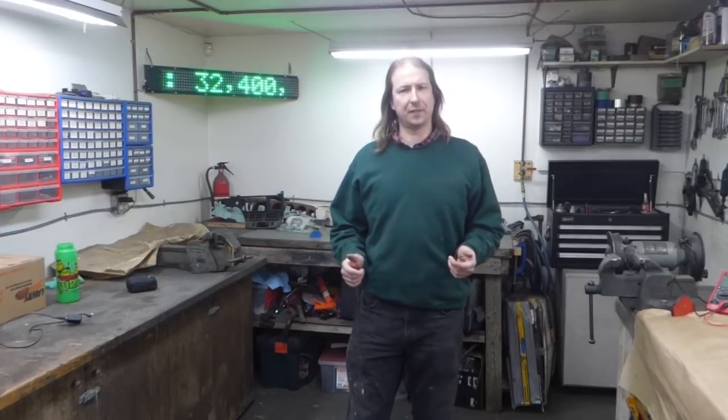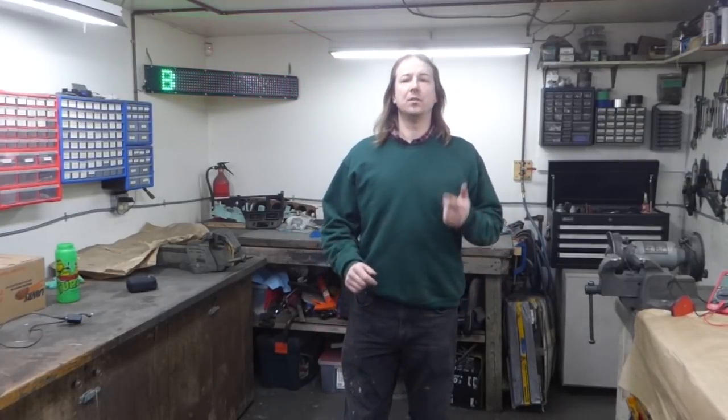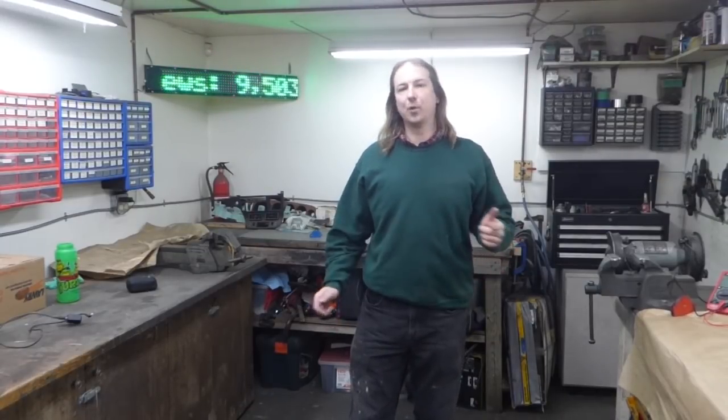So what I'm going to do is design a custom control board that has all of the I/O that I need. And I'm going to do things a little differently. Normally I would etch these boards myself, but in this case, because I want to be able to do a lot of surface mount stuff, double-sided boards with the proper solder mask and all that good stuff, I'm going to have them fabbed by PCBWay. And what does this mean? It means I gotta spend some time on the computer.